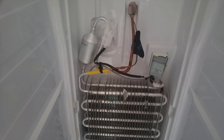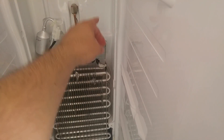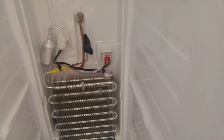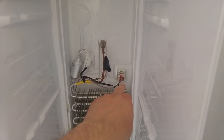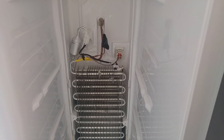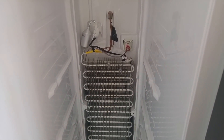Now let's see what we've got exposed here. I think we've got three sets of wires, and this metal casing seems to cover up things going to the outside or to the back where the compressor will be. It comes off easily enough. I'm going to pull the connectors off one at a time and see if it gives me different error messages so I can work out what's what. The upper connector, which has a thick red and black wire, is not changing the error message - it's exactly the same. I'm disconnecting with the power off and turning it on to see the errors. That thick wire is going to be the heater coil wire.